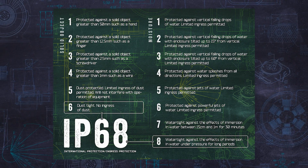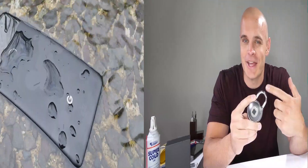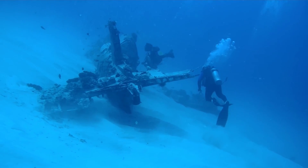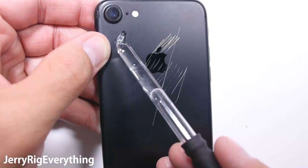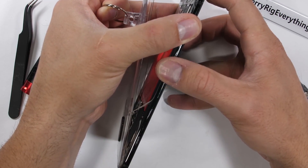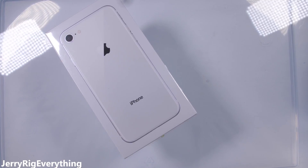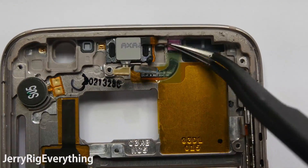But no matter how well you know the code, there are still lots of reasons you should keep your phone away from water. First thing to keep in mind is that all of these IP tests assume that it's fresh water. Salt from the ocean or chlorine from the pool can cause near instant corrosion. After scuba divers get out of the salty ocean, they'll rinse off their gear with fresh water so that salty corrosion doesn't have a chance to set in. Also, if your phone is about a year old and it's been dropped a few times and experienced temperature fluctuations, all of that can compromise the adhesive and the IP rating over time. And even if the phone does have an IP rating, almost no manufacturer will warranty water damage. There are little white stickers attached to the motherboard that turn pink when wet — they're inside every smartphone.